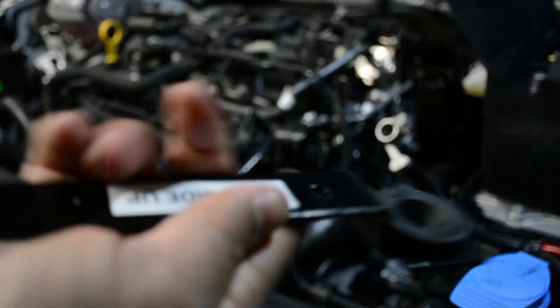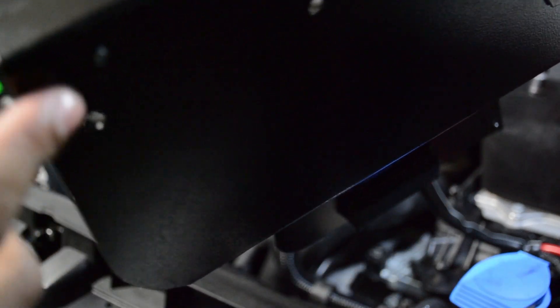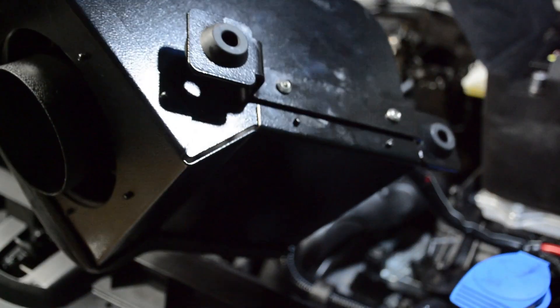So the next step we'll be bolting this piece with the nuts and bolts included with the kit. They'll be going in this portion of the box which is right below here. In the box there are two holes in the heat shield — here and here — that's what these are going to bolt up to. Then you're able to push it down where the battery tray is in the car. At the end of the day, it's bolted up like this, essentially like that.